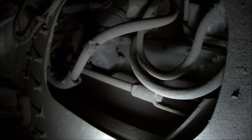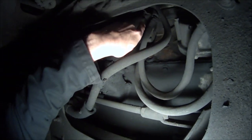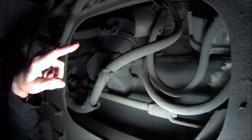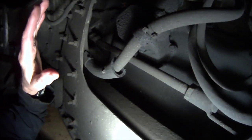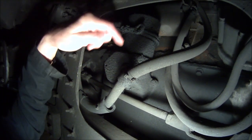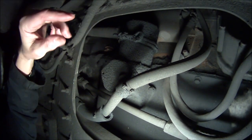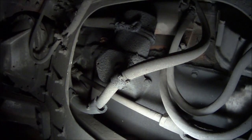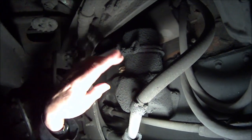Now we're in one of my favorite spots — this is the bulkhead right here between the engine and the rear axle, and we're between the two. This is the starter on the front side of the motor. Looking at the back of the bus, it's on the front side toward the front of the bus. This is that breather, and this is the plate that starts right here and goes down to the oil pan. It's really wide because the engine is laid over on its side. I haven't cleaned this thing for probably over a hundred thousand miles. There's a steel wool kind of filter inside here — you take the thumbscrew off, take the top off, pull it out and clean it. This is what it looks like normally, which isn't terrible for a hundred thousand miles considering it's sucking up all the oil and fumes.